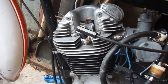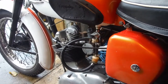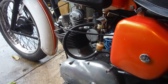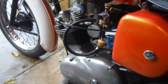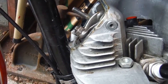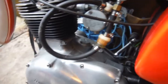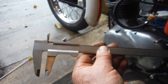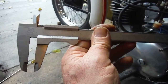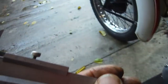I've been trying to determine what sort of camshaft might be in this T20M engine fitted in this Tiger Cub, as a lot of them of that era might have had the R camshaft as it's called, and the 9-to-1 or even 10-to-1 piston. I suspect there might be a high compression piston in this engine, but one thing I know for certain now is it has a standard camshaft. I've got the exhaust rocker cover off and I've been turning the engine, watching the valve move from fully closed to fully open, measuring the amount it opens on a vernier gauge — fairly accurately, to a tolerance I'd trust.